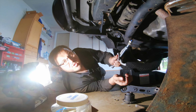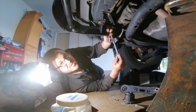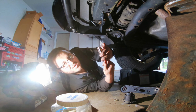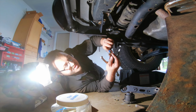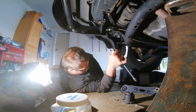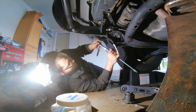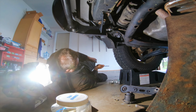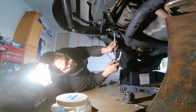So if you have a regular two jaw puller, you can disregard this. I'm using my half inch threaded rod. I'm using two nuts that I locked down here. I have one nut that's gonna hold my slide hammer two jaw thing. And then I'm going to use the lock nut method for this. So all you do is you butt up two nuts to each other and then you lock them down. So you just tighten both of them until they're snug. Those ain't going anywhere.